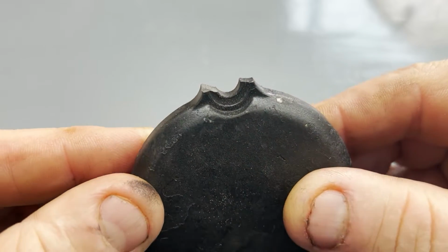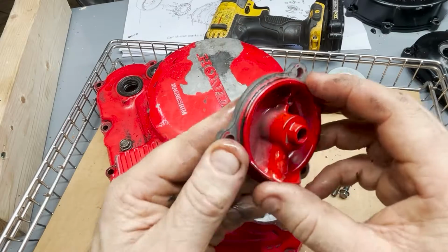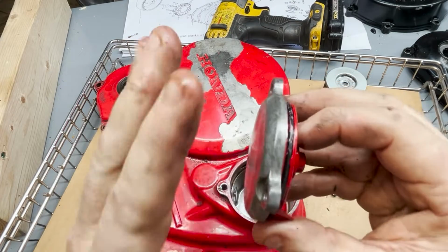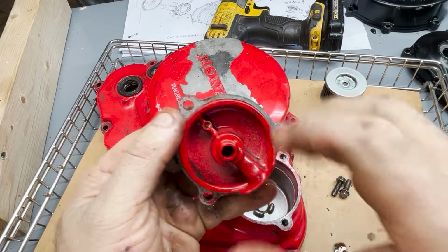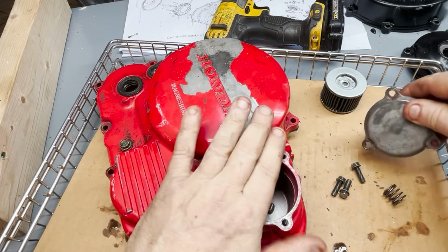All right, there's no need to torque this thing to death. There's no need for it at all. That seal does the job, and the bolts just hold it in place, okay? Tightening it further doesn't compress anything. It just risks breaking the very fragile metal. Just a word of advice.